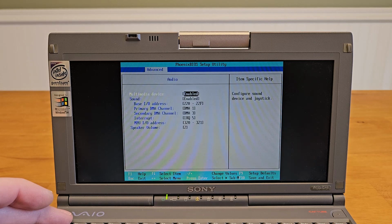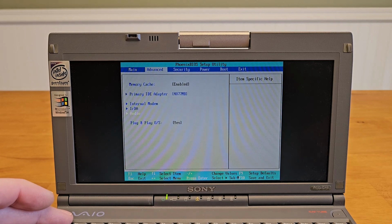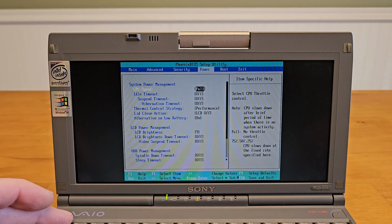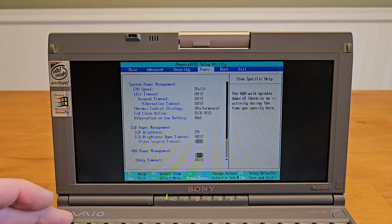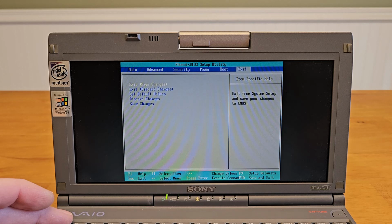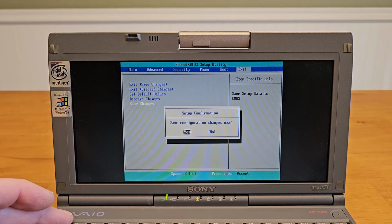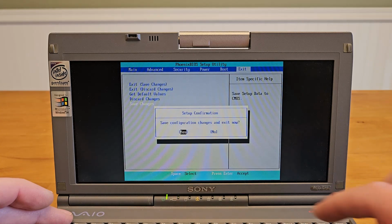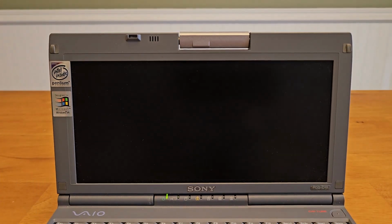It does do a model check, and the first check was easy to bypass because you just comment out a line in a batch file. However, all the files are stored in a .pac file, which seems to be a proprietary Sony compressed file, and the unpack tool also seems to have a model check. I tried swapping a few things around, like taking the unpack tool from my C1S, replacing the one on the C1X media. That didn't seem to work. Maybe it's a slightly different file version.